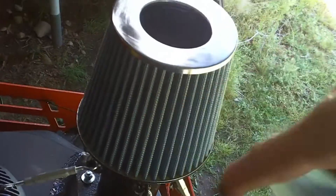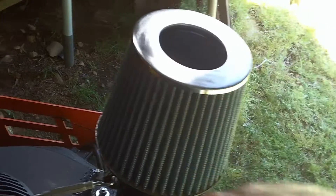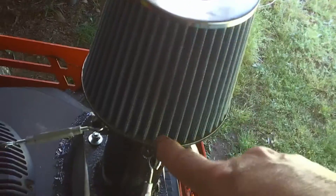What I'd really love to do is put a tractor-style cyclone system up here. If you know about it, older tractors had this system — no air filter, just a cyclone that throws dust and debris out while sucking in clean fresh air. That's the real system I'd like up here. On top of that I have this pre-filter I just bought off eBay — that will stop the big particles. I'll use bobby pins to hold that down; it can be washed or cleaned, and that adds extra filtration.